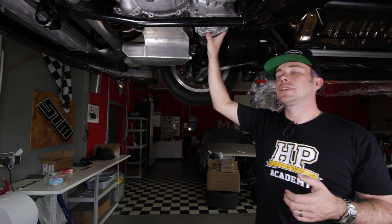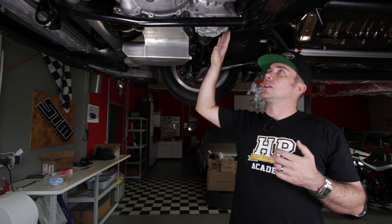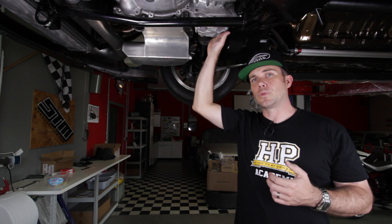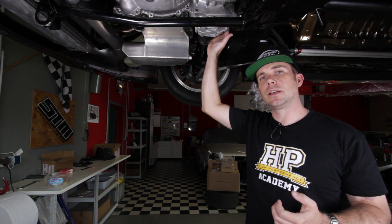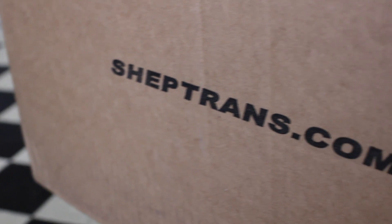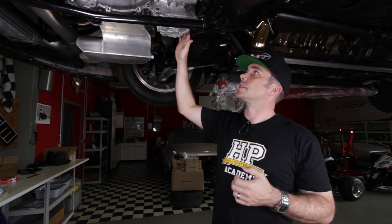Moving back we've got the transfer case. This is one of the weak points in the Evo 4-9 drivetrain, particularly when you're punching out 1000 plus wheel horsepower. We had a lot of trouble with the transfer case in project DS9 and went through many iterations trying to find the perfect answer — we ended up changing the crown wheel and pinion basically after every trip to the drag strip. Paul's good friend John Shepard from Sheptrans in the US sent over his stage 3, which is the biggest baddest transfer case he does. John is no stranger to fast Evo 9s, having sponsored the AMS car.